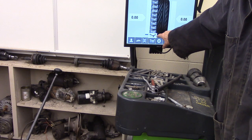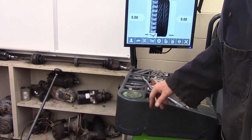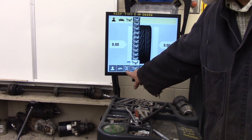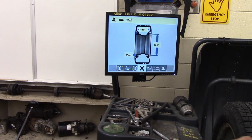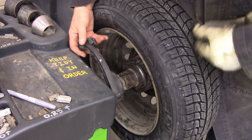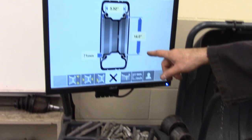Using the thumb wheel to the left to pick the weights. I tend to use clip-on weights on steel wheels, stick-on weights on alloy wheels, and we've got a lot of combinations in there. Then go to this one so we can tell the machine how big the wheel is and where the wheel is. Thumb wheel over there, center button. Pull this shaft out until it sits where the weight's going to go and tells you how big the wheel is.